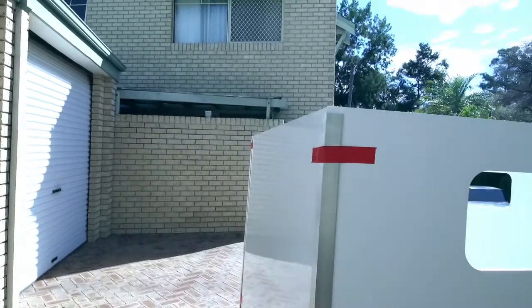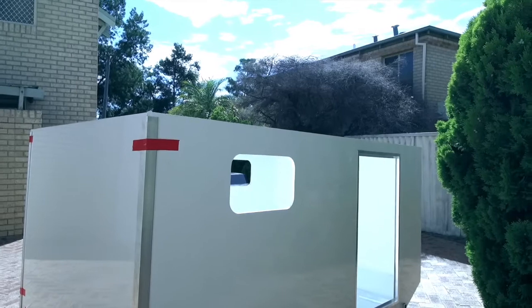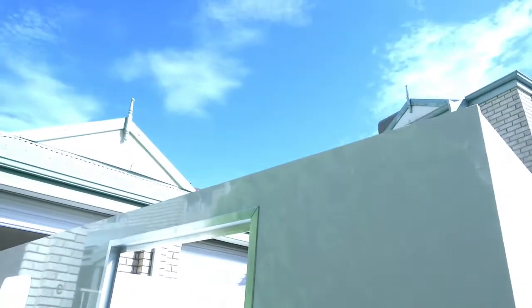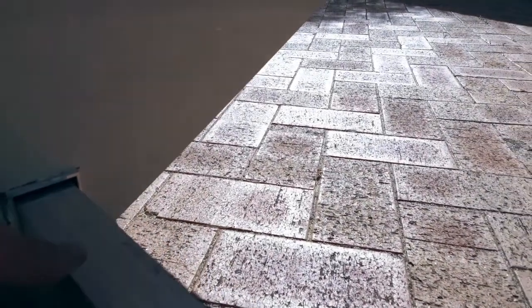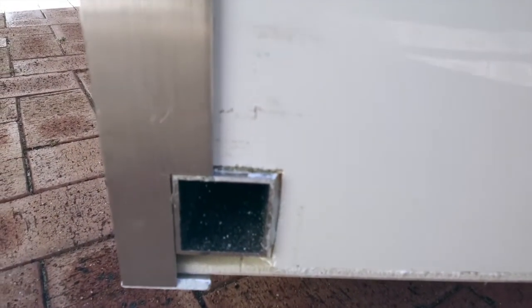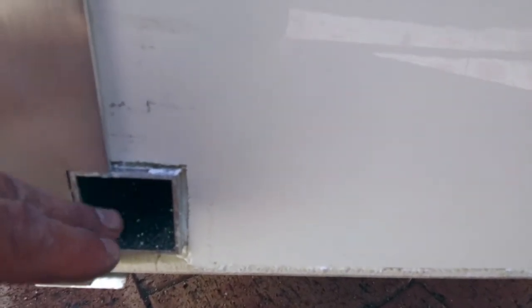So when you see this next time, it'll have all of the exterior aluminium trims fitted, the door frame will be completely fitted. I just want to show you this just so you understand how these jacking points are going to work. I'll just go down, take a bit of a closer look at this one here, so you can see how that just pulls out. So the jacking legs will just slide into there, and it's going through the wall, and it's going to have, as you can see on this side, the corner angle is going to be notched around it, and then there's going to be a bracket goes round here which will be bonded to the side as well, so the weight of the jacking leg in here will be pushing up not only on the wall but also on all of the support angles and support structure around that.